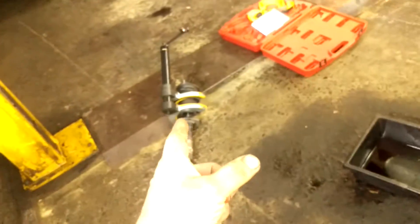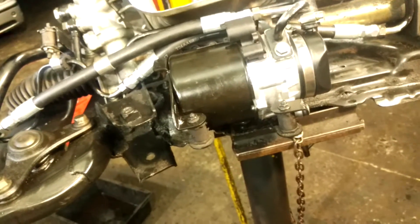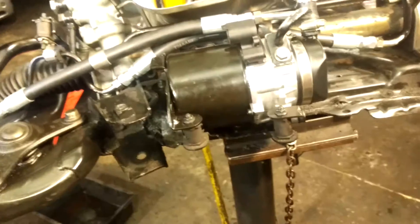These will be replaced tomorrow as I said. This pump was leaking for a while and then it just got out of hand — she lost her steering. The strut tops are seizing and creaking, which blows the pump. In this case I've decided to replace the pump before I get a high resistance code from the steering system.